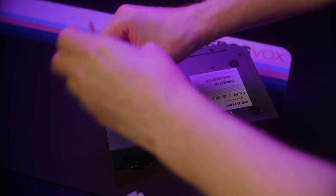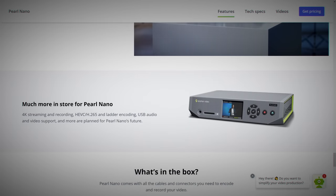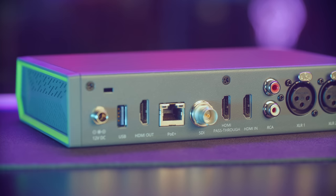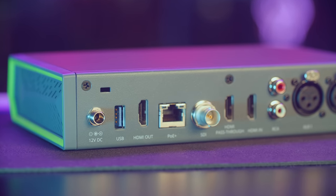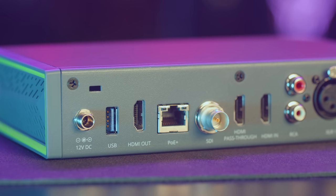Currently the HDMI and SDI inputs max out at a 1080p60 format, but Epiphan's original marketing says these can be upgraded to 4K with an update later on. I personally get annoyed at the lack of 4K support on new devices in 2021, but in the real world most people aren't trying 4K broadcasts, and even Blackmagic's ATEM Mini Pro line is all 1080p. The USB port supports USB hubs and connecting multiple devices such as a keyboard and mouse, or even USB microphones, but it does not work with USB capture cards or webcams over USB.